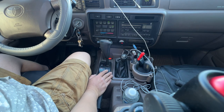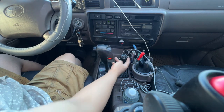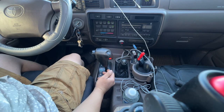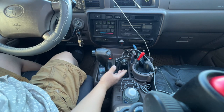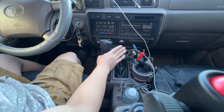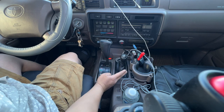So how do you use the gears? When you're driving in the city or on the highway, you're going to drive in high gear — you only have high and low. If you were to put the transfer case in neutral and then put it in drive, whether drive or reverse, if you give it gas the vehicle is not going to go anywhere because your transfer case is disengaged. So be cautious of that. You always want to be in high gear in the city. The only time you want to use low gear is when you're off-roading, stuck, or you want less wheel spin.